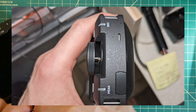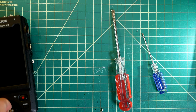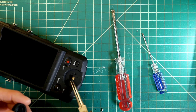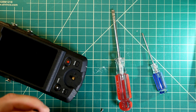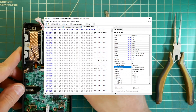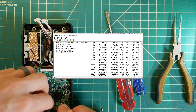So we know the PortaCapture X8 has the hardware to do what Tascam alluded to. How is it doing it? Well, I recorded four samples. I first removed the microphones and recorded the noise floor at 0 dB gain and 36 dB gain. Then I put the mics back on, shoved it into a fan, and recorded the loudest white noise I had at hand, again at 0 dB and 36 dB. Then I opened the WAV files with a hexadecimal editor, a RIF file editor, and loaded the samples into MATLAB to explore the values recorded.